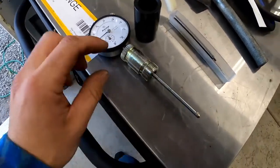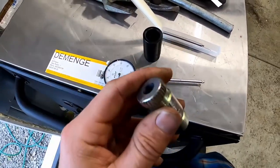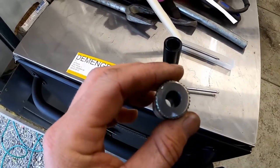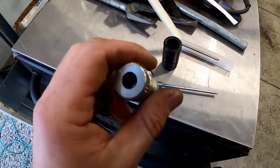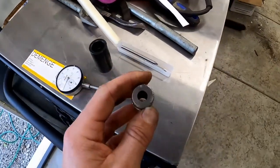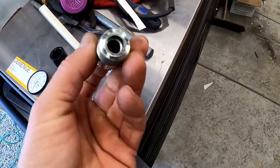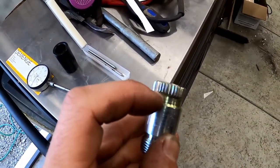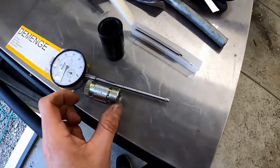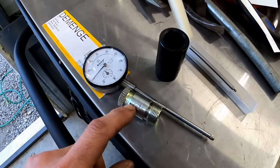Here's what we're looking like so far. It was a lot more difficult to drill through than I thought because there's hardened steel inside along the spring and a bearing. I had to hammer it quite a bit, break that hardened steel into pieces, and knock it out a little at a time before I could finish drilling. We got it done and now all I need to do is put a set screw here to hold the gauge and we'll be ready to pull out the delivery valves and set the timing on the pump.